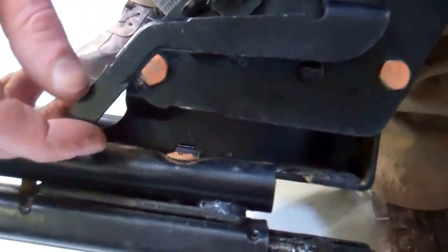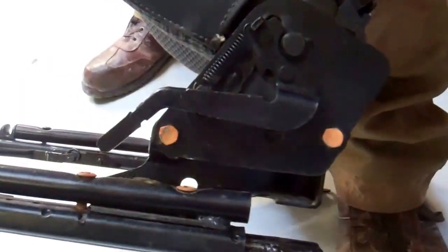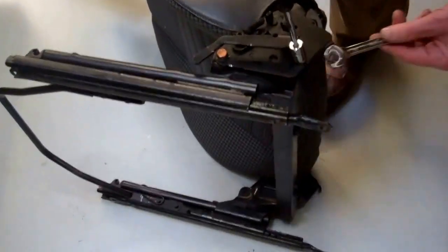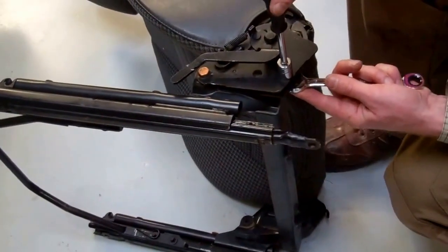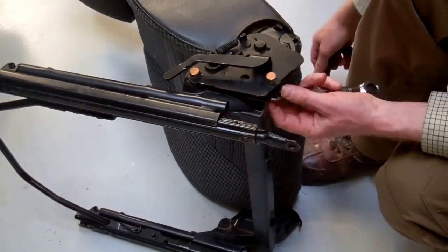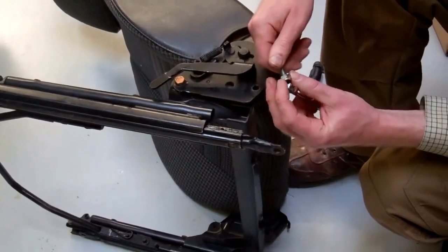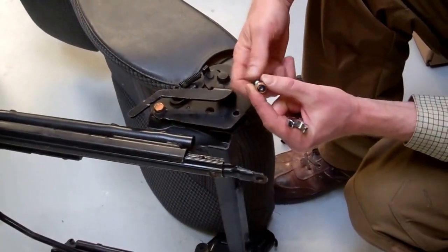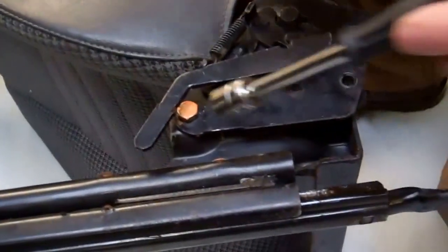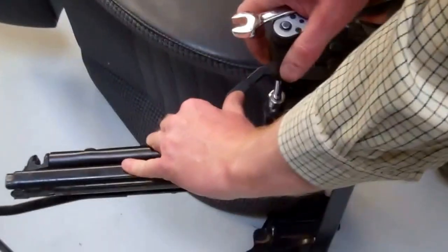So we're going to remove, if you can see them there, those two orange bolts, that one there and that one there, and remove the back so we can get to all these bolts and do it all nice and easy. So we're just going to use a 10mm spanner and 10mm socket, and we're going to undo these two here. Okay. Right, I'm going to put those back together. So there's a locking nut, a nylock nut. Tom used to call those stiff nuts, but whichever description suits you. Right, now I think it was easier to get to when I pulled the recliner there.